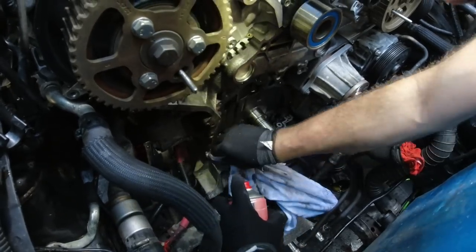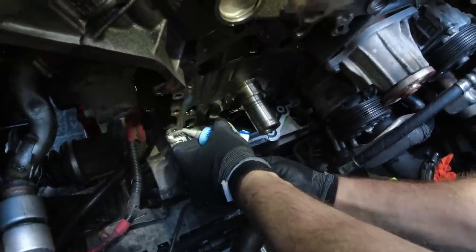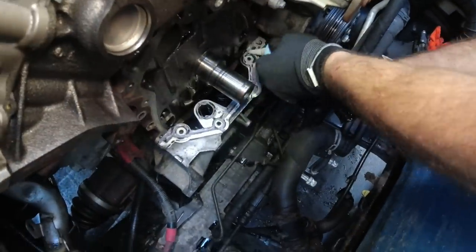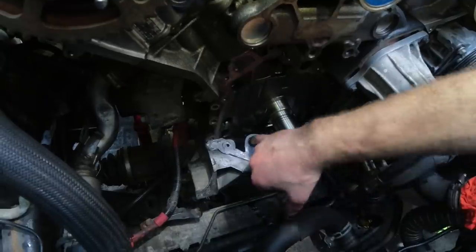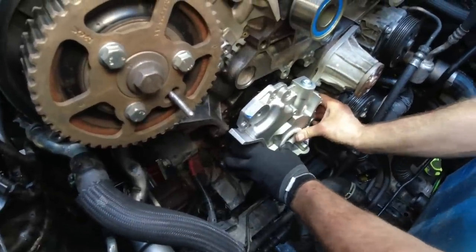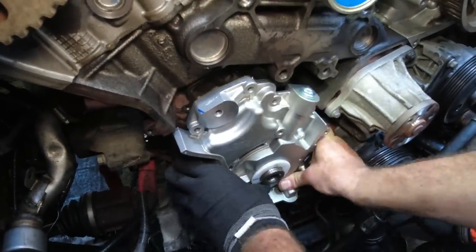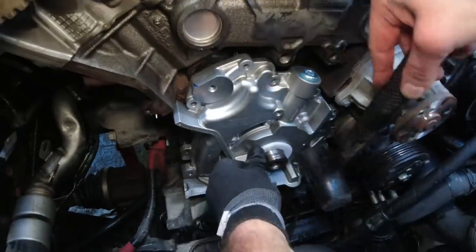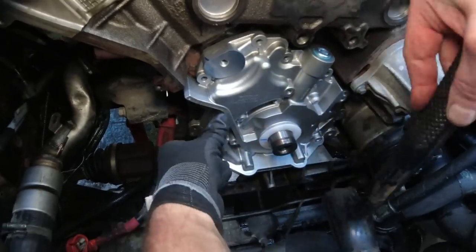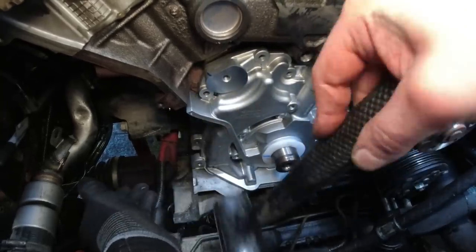Cleaning with spray cleaner. I put a thin coat of glue on, mainly in the corners but also over the entire surface. When I push it on now, I want to make sure the insertion tool stays on — all the way until it hits the shoulder of the crankshaft. See how it scoops the insertion tool out. The pump is not primed yet — I'll show you guys later how to prime it without making an oily mess.